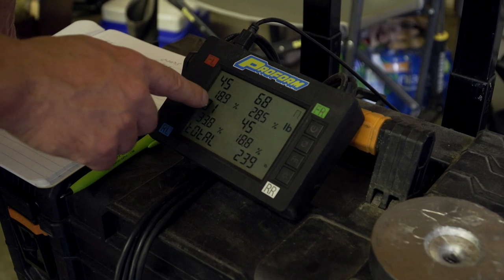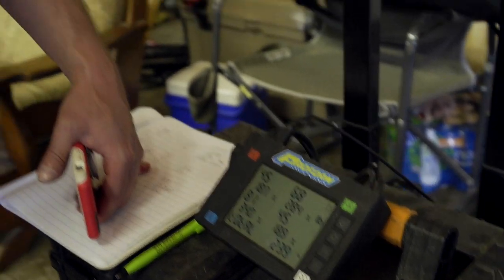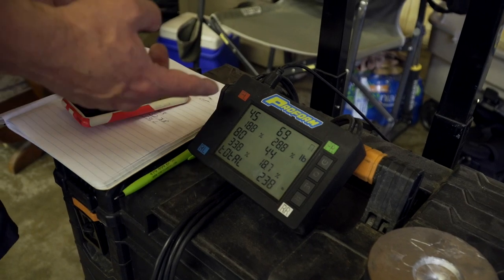On the rear, you want to add your rear weights up: 81 plus 44. There's also a thing called left rear bite. Left rear bite is not a percentage — it's basically how much difference the left rear has over the right rear. So you've got 80 pounds left rear, right rear is 45 — that's 35 pounds of left rear bite. That's another thing you can tune. It's a bit harder in karts because we don't have suspensions, but in stock cars we use cross and left rear bite a lot more. But that's another thing you can look at.